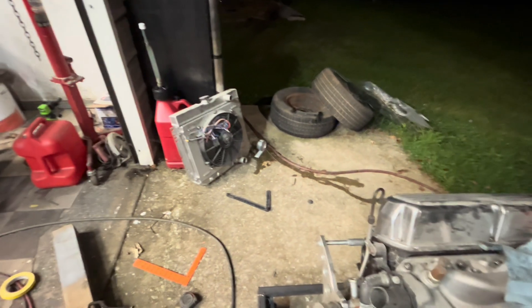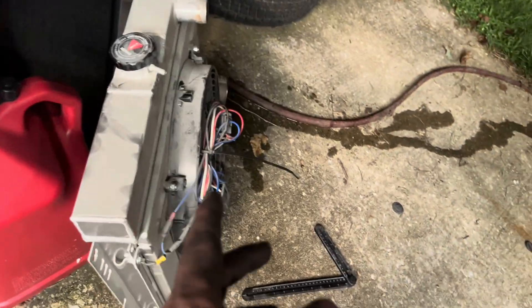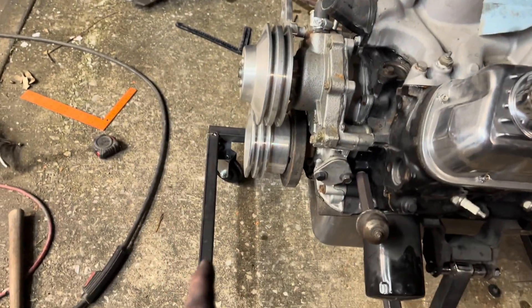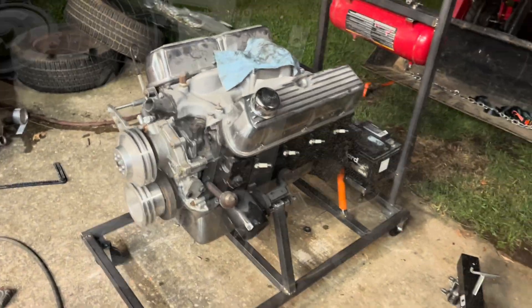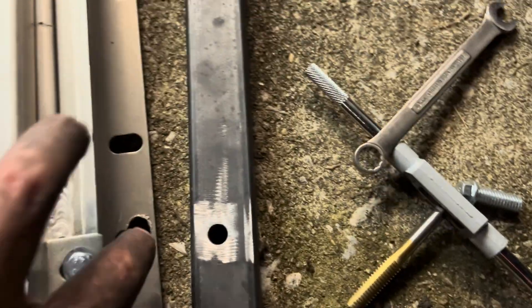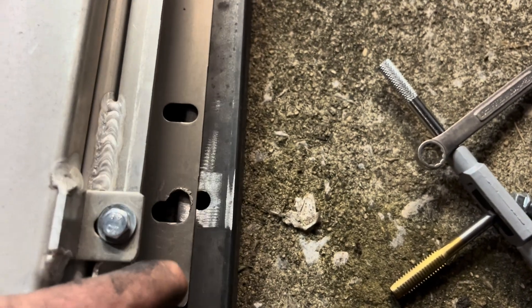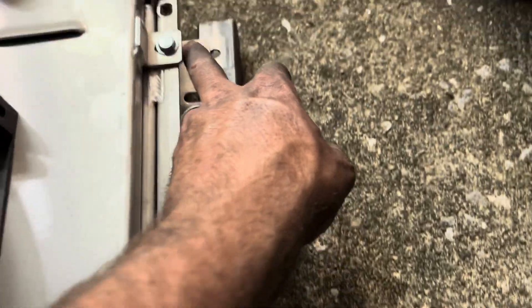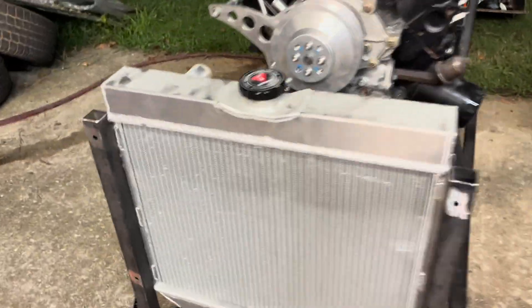I've got the battery sitting in place and I have my aluminum radiator over here. I'm checking that with my fan because I want to make sure my electric fans are going to be far enough away from the water pump pulley. Now I'm going to be making my bracket off the front for my radiator. To make the mount I've drilled my holes and used a 3/8 tap so I can mount them up just like a factory car would be — basically in those holes right there, already dremeled out. Put a 3/8 bolt right here and that'll hold the radiator into place. There's my radiator bolted into place.